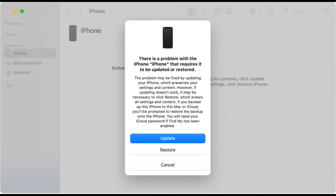The application will start downloading the latest iOS software, verifying and installing it to your iPhone to reset it even when it's off. Wait patiently, as the process might take from 1 hour to 3 hours. As long as you see the Hello screen, the factory reset on your iPhone is successfully done.